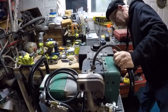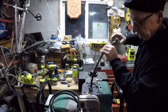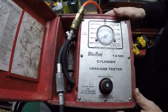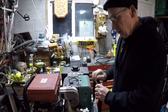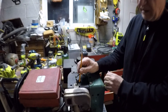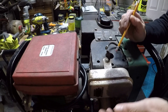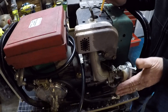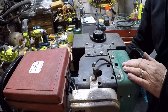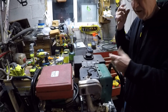The last test I was taught is to find out where the compression or the air is going. The next setup will be a cylinder leakage test. We're going to pump air down the spark plug hole with the two valves closed, and we're going to put a certain amount of air into it. We're going to listen either through the muffler or the carburetor if air is leaking through, or whether it's going down the crankcase. If it's going down the crankcase, you should hear the air coming through where you fill it up with oil.